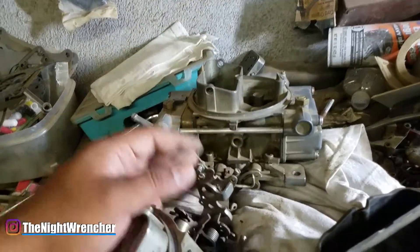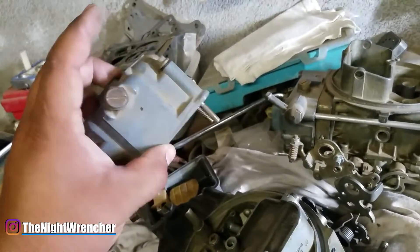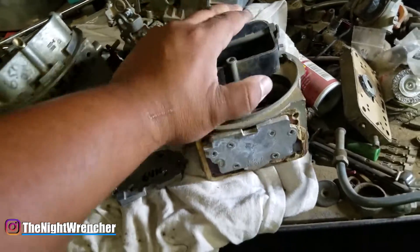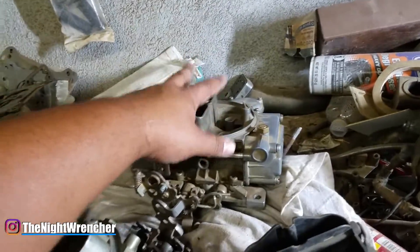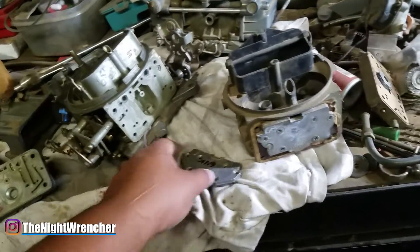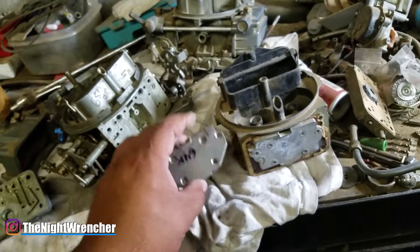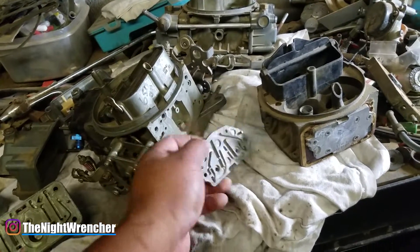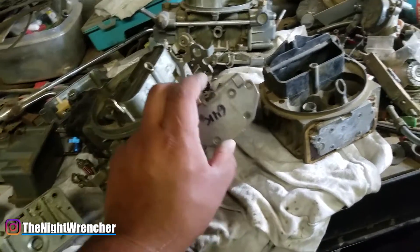Let's say you want to turn your 1850 into a more race-oriented carburetor. You remove the choke tower for extra CFM, remove the bowls, and convert to center-hung float bowls. For the secondary metering side you have two options. Metering plates are pre-calibrated settings that act as your main jet, but fully converting your 4160 to a 4150 requires removing the secondary side completely - the float bowl and six screws - and tossing the metering plate. Plates are expensive, hard to meter, and jets are readily available, so I don't typically recommend the plates.